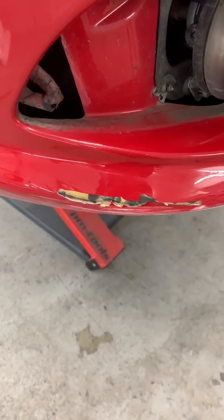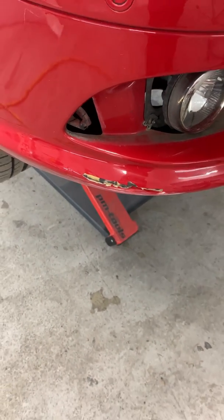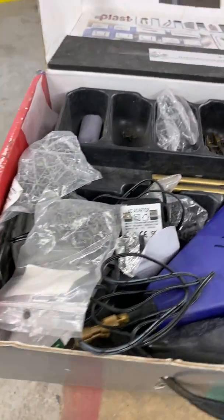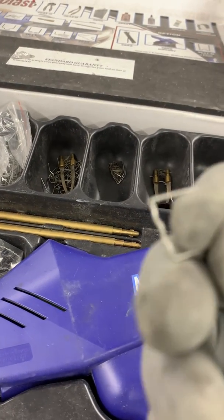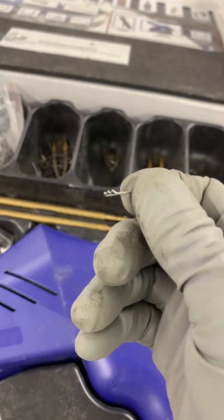Polyurethane plastic is a thermoset plastic. That means it cannot be remolded. It cannot be heated up and welded like you would a normal plastic like polypropylene, PP or ABS. So you can't use staples — they will just fizzle and fall out. The plastic doesn't actually fit around them.